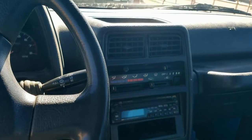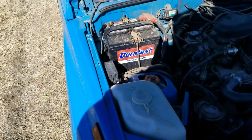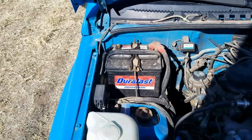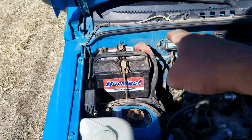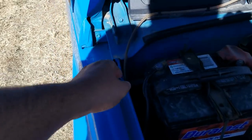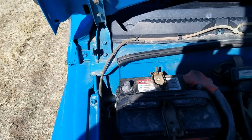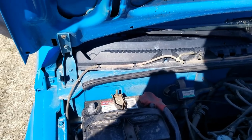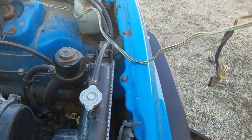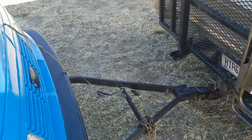While the radio works and everything, if it's a short tow it won't hurt anything. But a tow over an hour or two, you need to disconnect the battery. I learned this from Furrier Tire and Automotive — I was disconnecting the positive every time, but my friend Paul said that'll spark and short out your computer. Always disconnect the ground. We want to save that computer — that's how I'm going to do it.